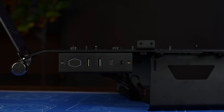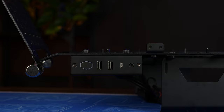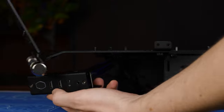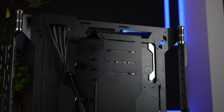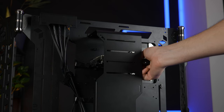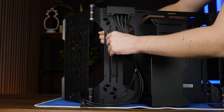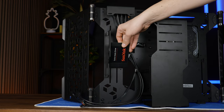The I/O is pretty cool though. There's a little bracket with a USB 3.2 Gen 2 Type-C, two USB 3.1 Gen 1 Type-A, and a combined audio in/out jack. And of course, the very clicky Cooler Master power button. You can mount this onto the backside of the main plate with the I/O facing away from the case, either at the top or the bottom depending on your use case. For hard drives and SSDs, there's quite a lot. Four rails on the back panel for four 3.5-inch drives, or 2.5-inch drives using two screws. There are also another three 2.5-inch spots on a bracket that mounts onto the side of the main plate — and yes, the SSDs are meant to be installed slightly tilted.